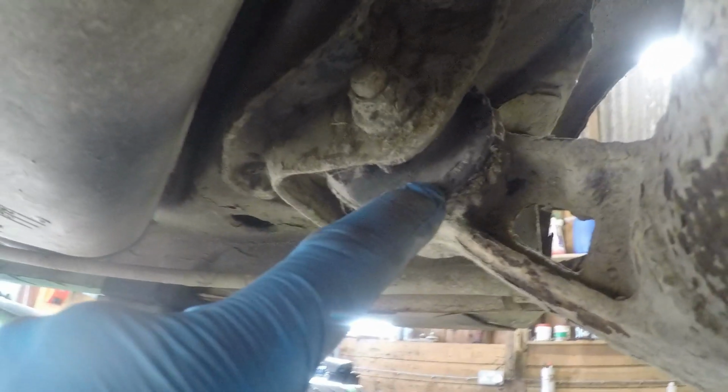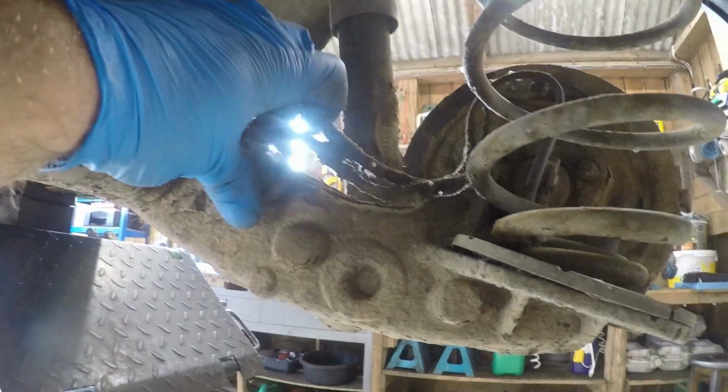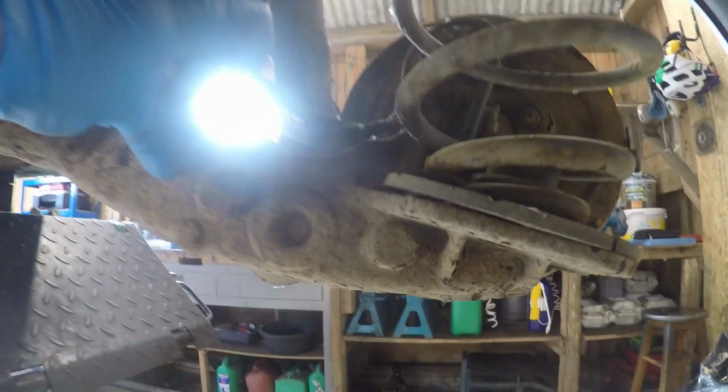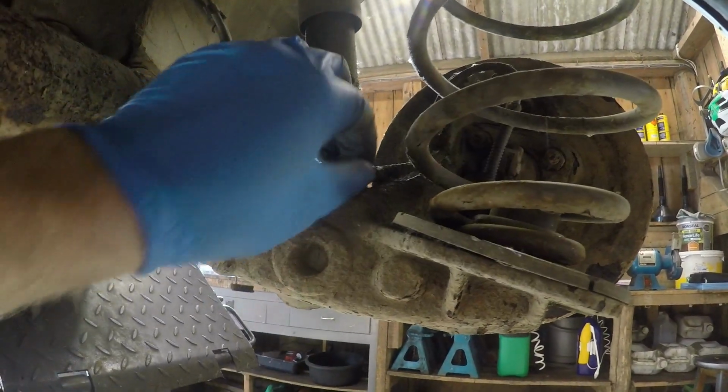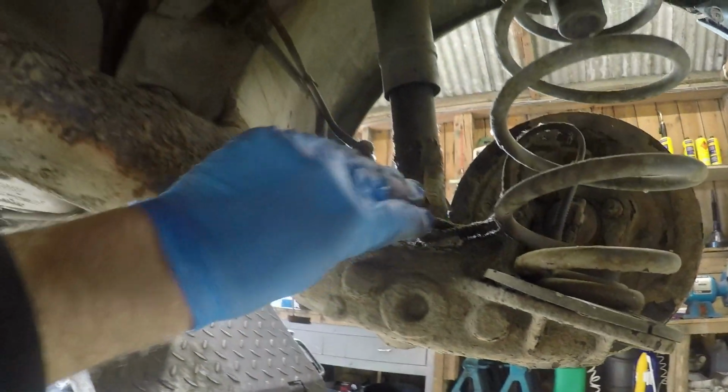These ones actually look pretty decent, but the 5-door turbo has actually got poly bushes in the axle, so if we do the 5-stud conversion, it's probably easier just to swap the whole axle over. Although the 5-door is sort of the early Mark IV, so it has the Bosch calipers on the back. So the calipers and the handbrake cable are slightly different, but again, it's not a big deal to change. I've got everything here to do it. It's a shame this exhaust shield wasn't the same as the GSI's, because that would definitely be coming off. So long.